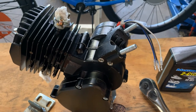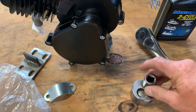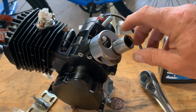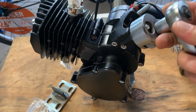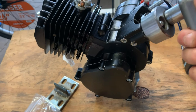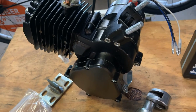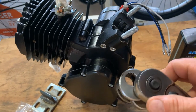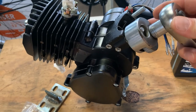I'm going to show you, for those who don't know, a stud removal and installation tool — it's designed just for studs. It slides down on top of the stud, you put your ratchet in there and go the direction you're turning the stud. It doesn't hurt the threads, so you can tighten your studs and make sure they're 100% in. Same way in reverse — the wheel just flips itself around, you turn the ratchet around, and now you can take the stud out.